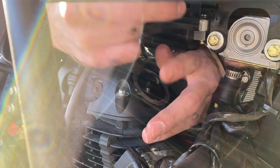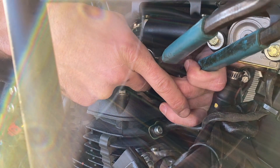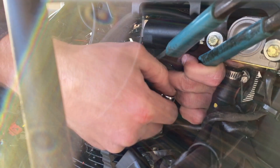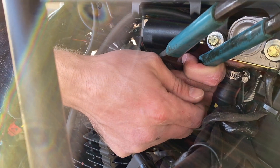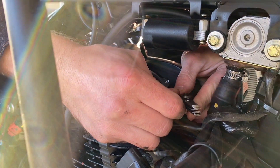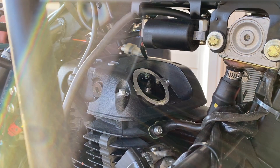Just want to put a little bit of pressure on the valve itself — not clamping, just pressure. We'll recheck measurements to make sure it didn't get any bigger. Eleven does not go in, and ten goes in — perfect. So now we can put that cover back on.